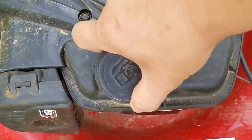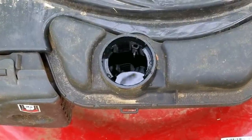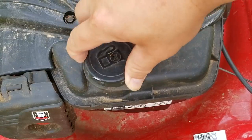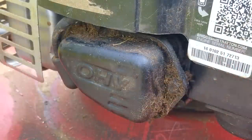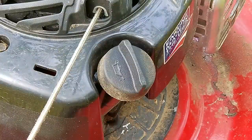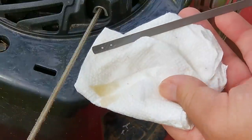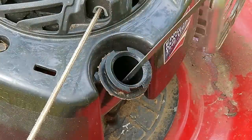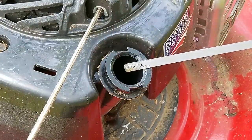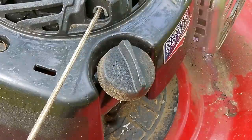As you can see, there's probably about $10 worth of gasoline in the tank, so even if this mower turns out to be scrap, I'll at least be able to use the gasoline in it. Considering the age of this mower, I might also have to inspect the valve lash, because more than likely it's probably never been done before, and I want to make sure it's going to run well for the next few years. After checking the oil, you can see that the color is really good — that can only mean someone was taking care of this mower. After checking the oil level, it turns out it's full, so I have to wonder if the person who threw this mower away was a different person than the one who was taking care of it.